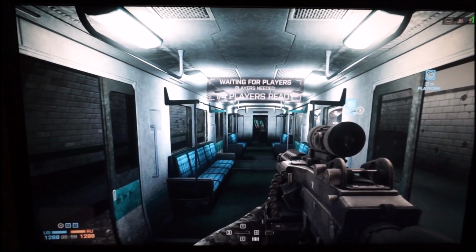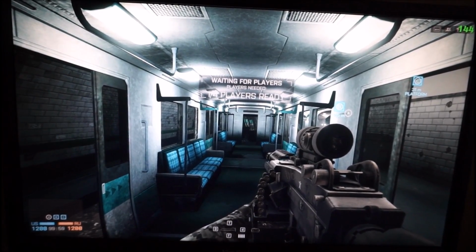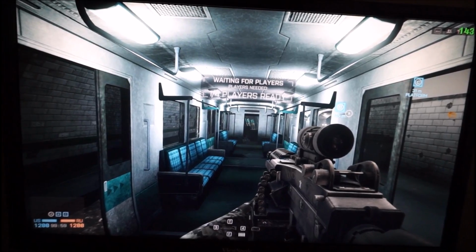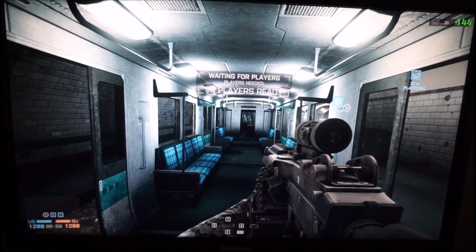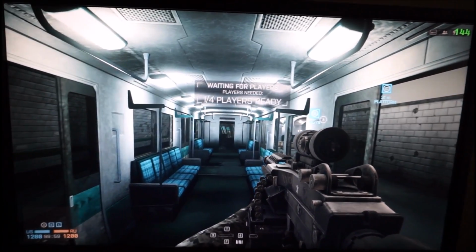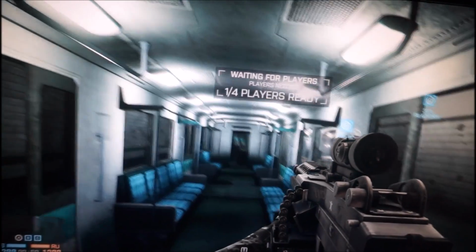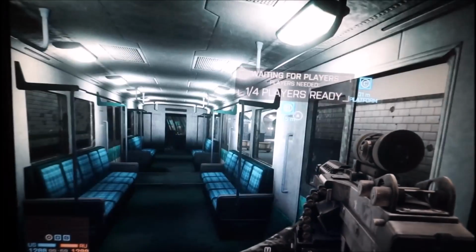The first thing I notice anyway, is that the monitor uses a matte anti-glare screen surface, a regular matte anti-glare screen surface, or medium some people might call it. That's a sort of middle ground. It's not as light as some screen surfaces. For example, high resolution IPS type monitors and VA monitors tend to use lighter screen surfaces which have a smoother surface texture as well. But it doesn't have the sort of heavy smeary grain that you see on some monitors either. But certainly when I'm looking, again this won't come across in the video, at lighter shades such as the lights there, and to an extent the ceiling of the Metro as well, you can see a certain graininess. It doesn't look particularly smooth.